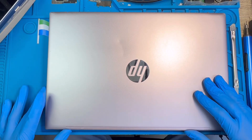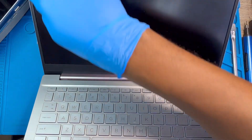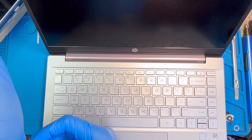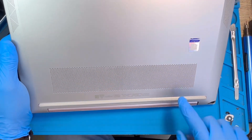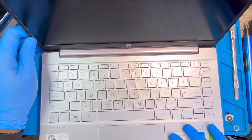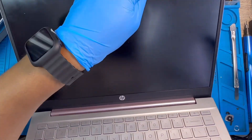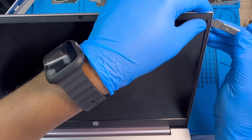Okay, this is a laptop. The first thing you have to do is try to remove the frame — this frame here, it's glued on, so you just try to ease the frame up. Sometimes, if you're not too good at changing it, you should open the back and disconnect the battery before you change the LCD. But if you're experienced, you can change the LCD without opening the back. The frame is very easy to open — you just ease the clip up like this.